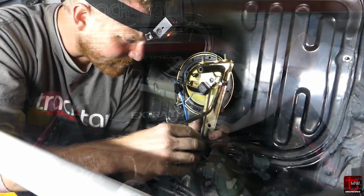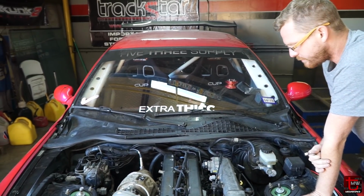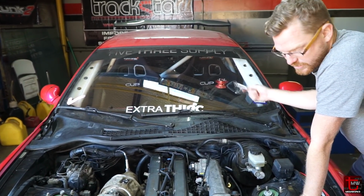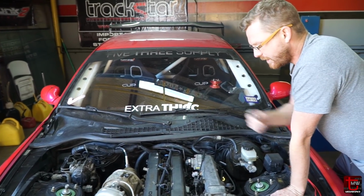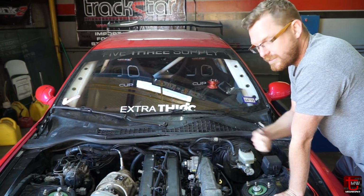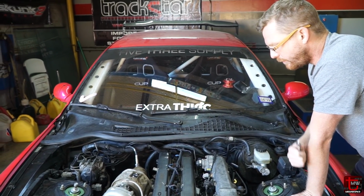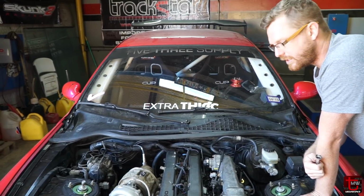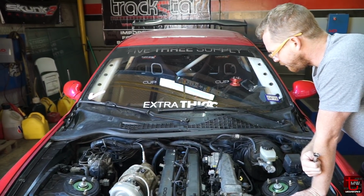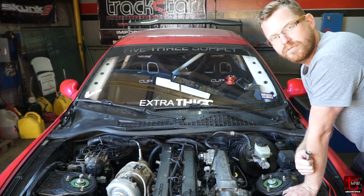That's sealed up. Then we had boost issues with the wastegate, where it was generating too much boost. We had talked about switching to ethanol anyway, and because of the boost levels we were hitting, we switched to ethanol. The car's running pretty good right now. It did several pulls yesterday with some pretty good power numbers. We're looking for a little more refinement and a final number today so that we can take it out and have some fun tomorrow.